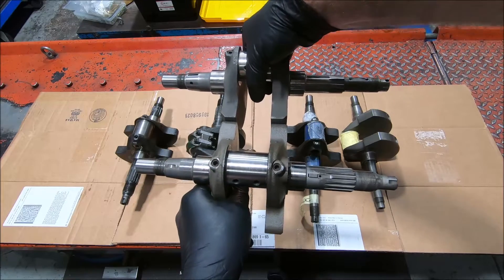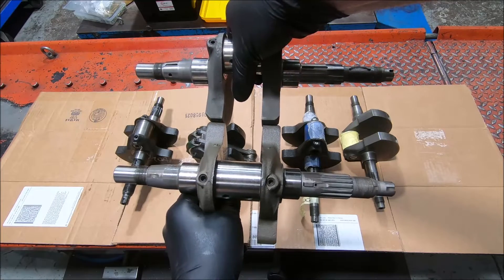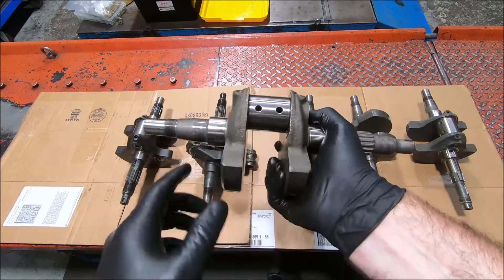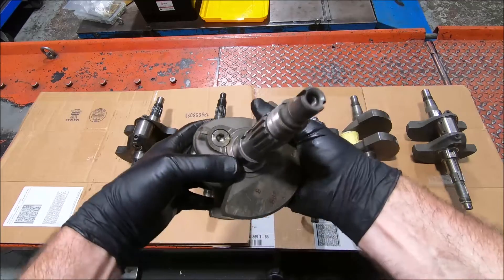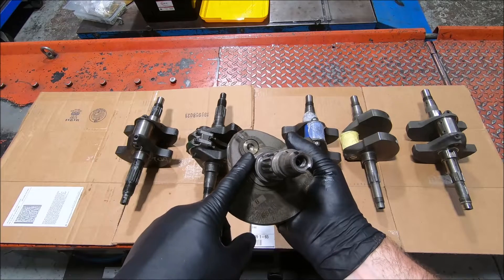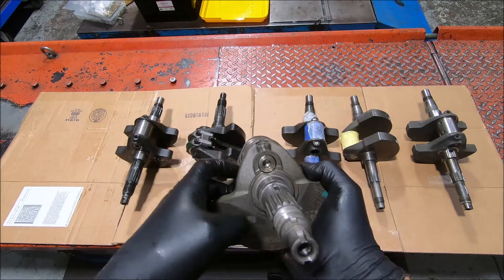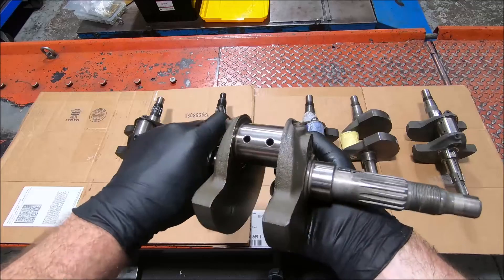You can see the differences between them - the difference is mostly the left-hand end, while the right-hand end is much the same. They all feed their oil into the crank from the right-hand end, from the primary drive cover, to feed the big ends. They have these drillings. I usually never pull the outer plugs out, but I would usually always pull the big end plug out and use green Loctite - the old Loctite 270-271, the never-come-out Loctite. I wouldn't rely on them just being staked personally - the really strong Loctite is the way to go.